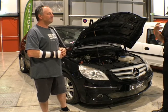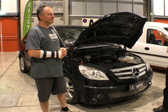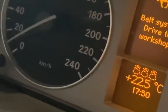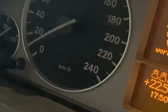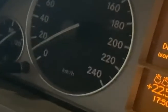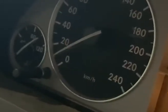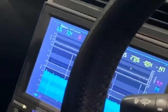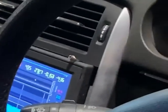If you drove it a bit forward or back, the steering would then turn on. We figured that's because the rear wheels are moving — the people who wrote the original program were thinking, if the motor's out and the wheels are turning, someone's probably pushing the car, so maybe we should turn on the steering. But obviously if you're parking in one of those tight spaces in the inner west, you're stuffed. So I got an Arduino module that pretended it was the rear wheels, and when you first turn the car on, it generates a signal like the car is moving. You actually see it in the speedo — it wiggles up and down. Because of that, you can start the car, sit there for 30 seconds, and the steering will start.